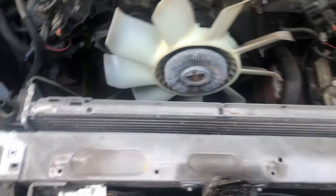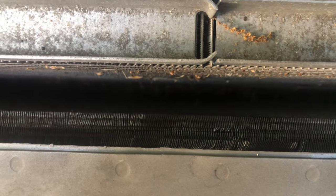Just about to pull the radiator out and discovered something here — let me get a flashlight. There's leaves in the middle of it. I've already got the new radiator so I'm still going to put it in. I don't think the old radiator was doing what it was supposed to do in terms of flowing water. I did want to show you this — it's squeezed in between the condenser and the radiator. Radiator's up on the top of the screen, condenser's on the bottom. That right there could be a problem.